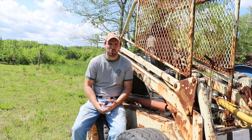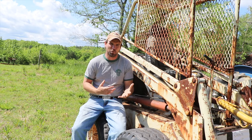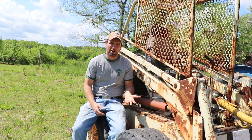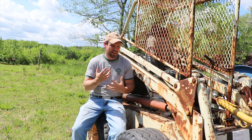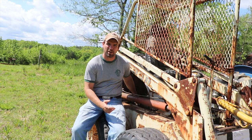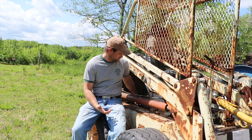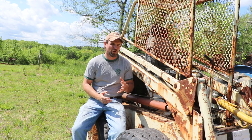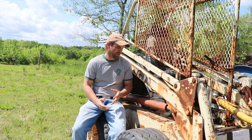What I decided I was going to do is just go ahead and fix the wiring on the skid steer, and then after that's fixed and Shauna has time, we'll come out and test it for spark. If we're getting spark and we've fixed the power going to it and the spark is hot, the next thing I'll probably look at is the firing order of the spark plug wires, to make sure they are firing correctly to the manufacturer's specs. If that is working, then that carburetor that we cleaned, I'll probably try and go back and replace. But that's about a $150 part, so I don't want to do that unless I'm absolutely sure that the carburetor is what's wrong with this.